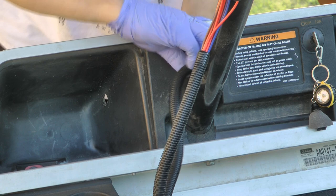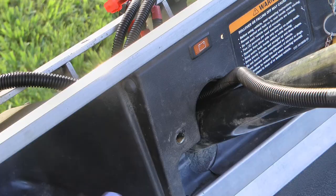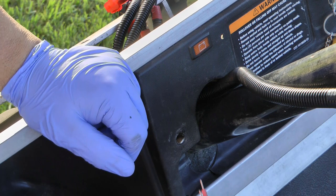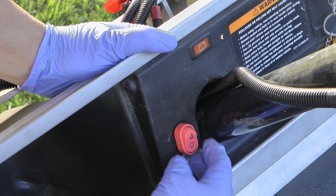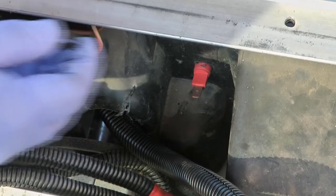So you see it can be done — I just cut some slits here so it would lift up and close back down. That would not have been easy had I not removed the top panel. Take your hazard switch, with the lock nut and wires already removed, and push it through whatever hole you're putting it in. For me, I'm putting it through where the old headlight switch was. If you don't have a hole, you need to drill one, then thread on the lock nut and tighten it so the switch won't go anywhere.